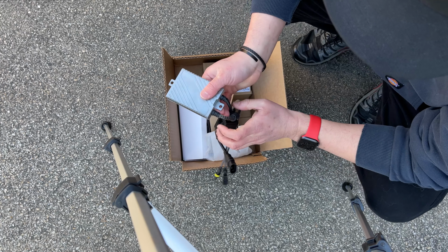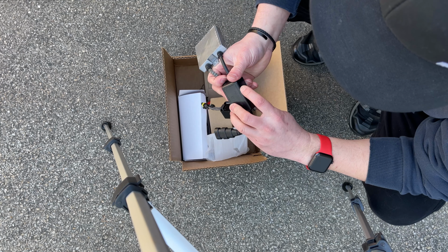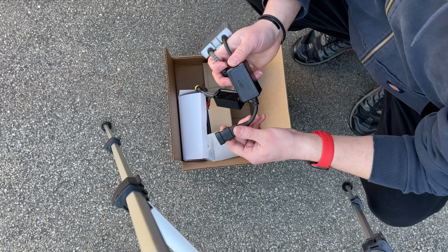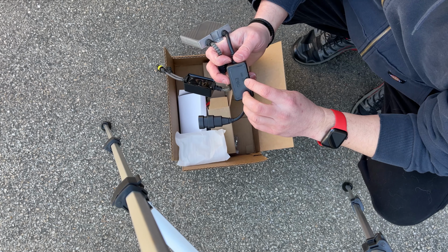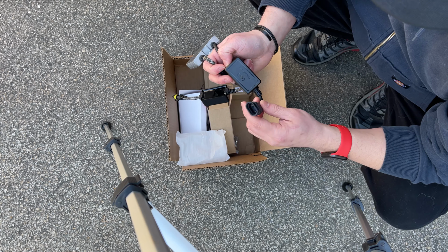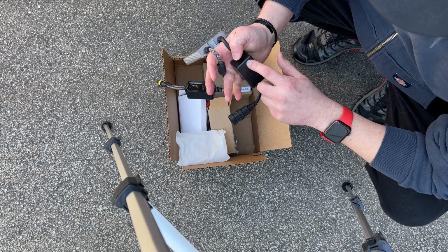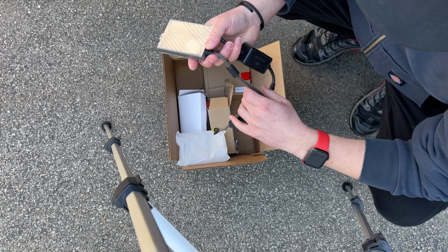This is the bulk of what we're dealing with here. This is the ballast. I think this is what tells the computer that there's nothing wrong with the lights, otherwise it might throw some codes. This is the car side. So it'll come out, plug into here, go through this decoder, into the ballast.